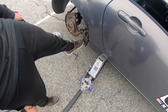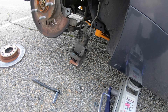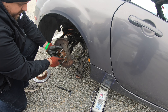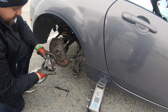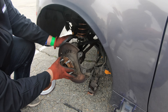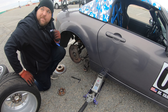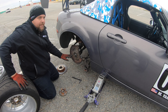The piston boot on the caliper had turned into gum — like goo. The hub showed it was like this when he got off the track. It was literally only a couple turns. We discussed whether the wheel not rotating caused it to unscrew, like maybe the axle was going forward — something had to give. The caliper was locked, like the e-brake was stuck. I'm so glad it happened going straight though.